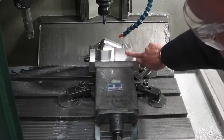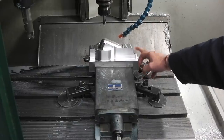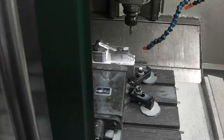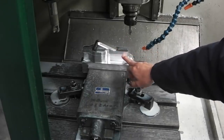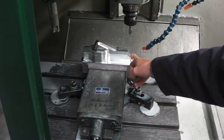Gone into the surface there. So I've profiled it, finished this end off, but I need to load a couple more cutters in. So, a bit more boring stuff. Okay, so that's as much. That's the flatlands finished, profile finished down to that line there. Got this area finished with the ball nose again.